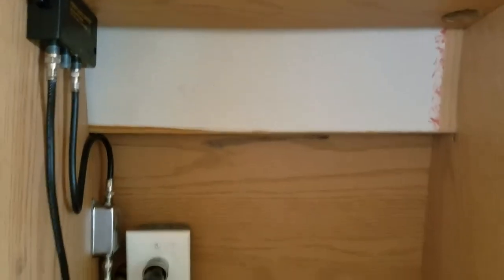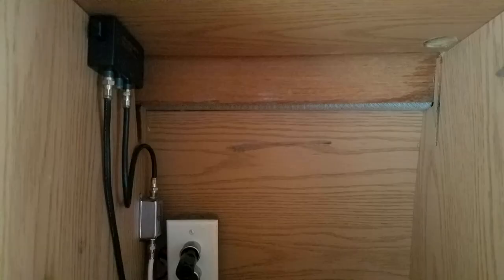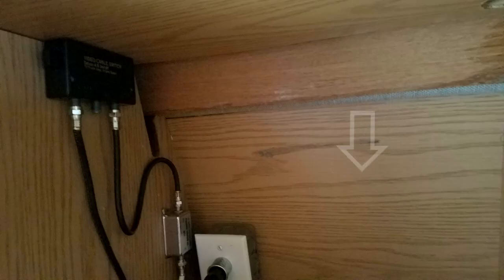Now the door will come down and drop right out the bottom. Before doing so, I wanted to show that the door goes across the top of the cabinets and down the back. If you have things stored in there instead of a TV, it can hit those things and the door won't open fully. You can see the grooves on the right and left — I cut quarter-inch plywood exactly the right size, a little tight, glued around the edges, and pressed it firmly into place just in front of those grooves to protect the door so it can open completely.